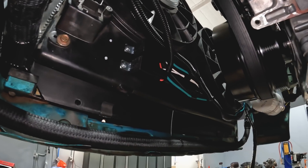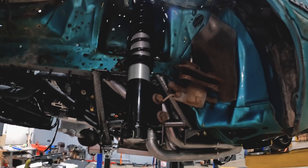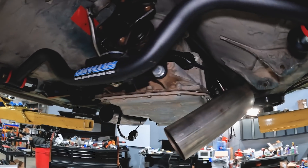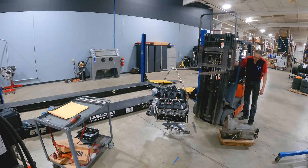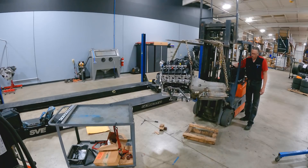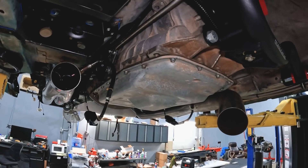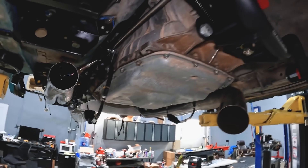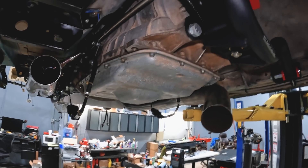There's the lower radiator hose and water pump, relays for the contour fans, and right here a Strange strut with coilover kit — previously in parts one and two you saw just an SVE lowering spring with a factory-style control arm, but that was just for mock-up. In the transmission area, a Stiffler's crossmember is holding up our 6R80 automatic. We decided on an automatic over a manual because at the drag strip it eliminates driver error and gives truer results. This 6R80 is out of a 2012 F-150 two-wheel drive with about 90,000 miles — we paid around a thousand dollars for it.